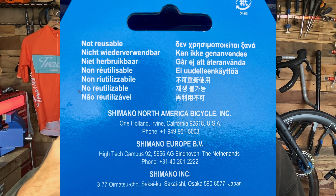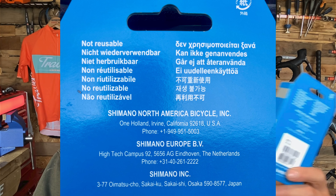Quick links are Shimano's easy way of joining two ends of a bike chain together. You may see them called different things by different brands — Power Link, Power Lock, C Link, Campag Connects Link — but they all do the same job. Most quick link packets say single use: put it on your bike, use it, take it off, put it in the bin. This can be a barrier to many people waxing their chains, as having to replace it each time can get quite expensive and frustrating.